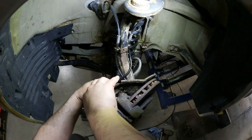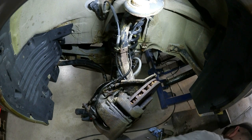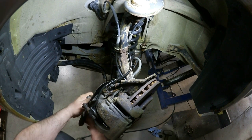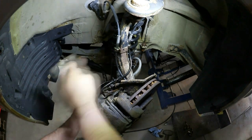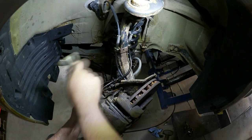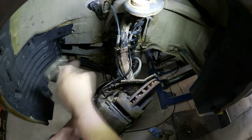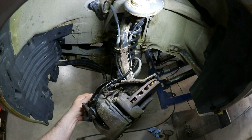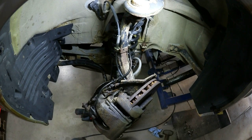This particular vehicle has a couple of plastic caps covering the caliper mounting. We expose the caliper bolts. They are a 7mm hex. As you're loosening it off, give it a slight backwards pressure to the socket handle. It'll allow you to remove the pin completely. A good chance to do a brake service as well, as far as lubricating the pins and cleaning up the pads.